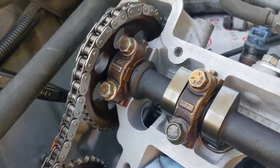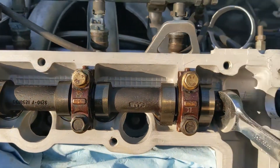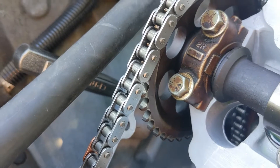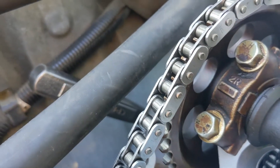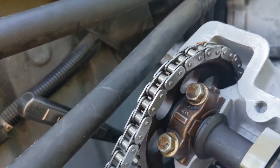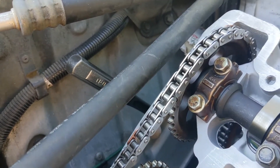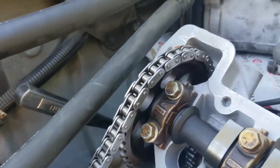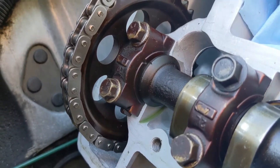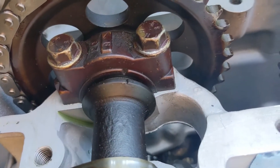I'll use a wrench on the flat to rock this up into position. You can actually hear the tensioner doing its thing right there. I don't want to put too much force here, just a little bit of lift to be sure the chain is in good shape. I could go just a smidge more - no, that's perfect. So I have a lined-up mark there, and a lined-up mark there. Kind of hard to see with the camera angle, but you'll get the idea.